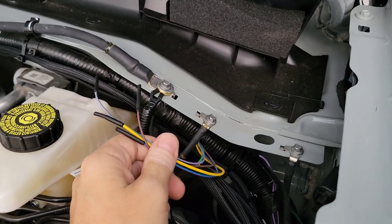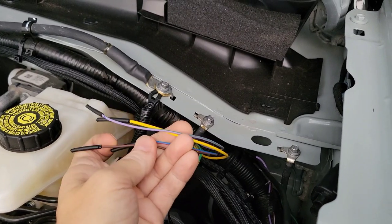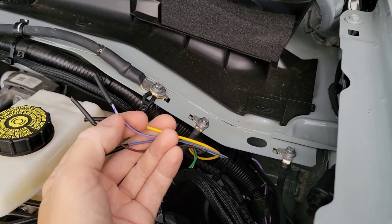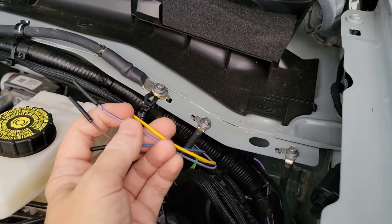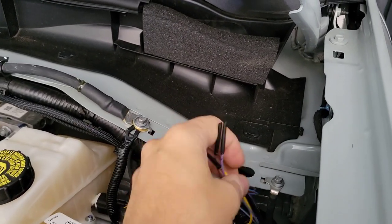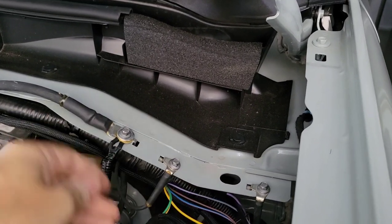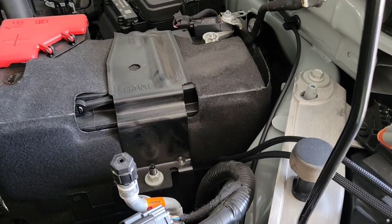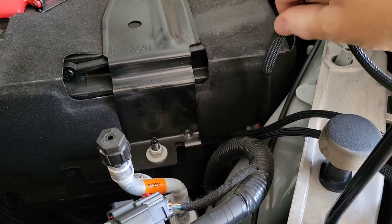What you can do is still keep your relay that came with your lights, and use whichever one of these wires from whatever switch — this will then essentially just be a trigger switch. You just hook this up to the trigger wire for your relay. I went ahead and ran the wires directly to my lights to power them because I did the math and they're fine for the amperage.